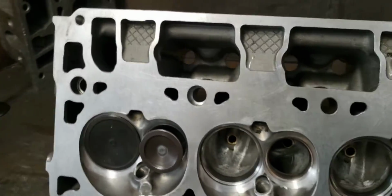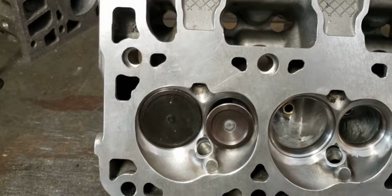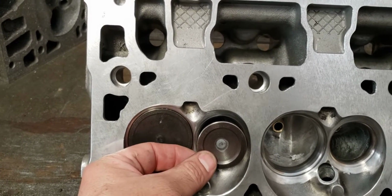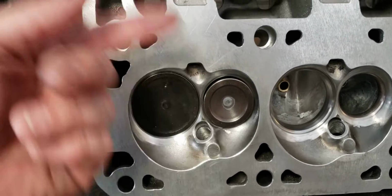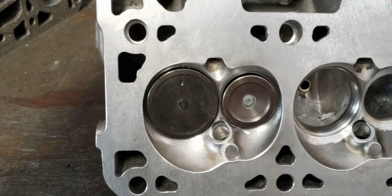Now, again, like I said, with cam overlap, as this valve starts to shut, we now have piston speed coming up and pushing the air out, which is great. Because really there's no more momentum. The explosion has happened. So now we're just relying on the piston. But like I said, overlap event happens, exhaust valve starts to close, intake valve starts to open.